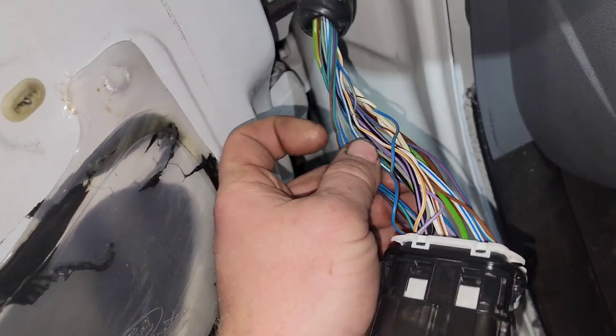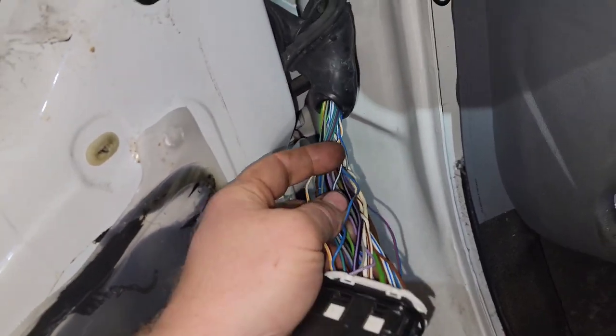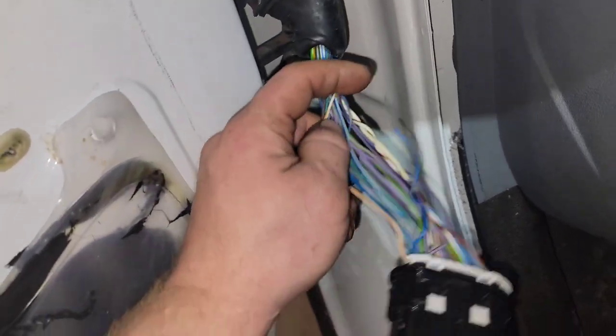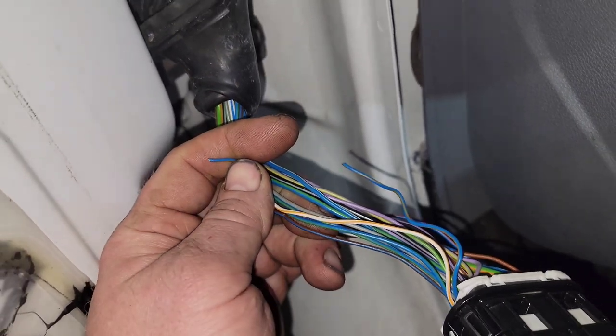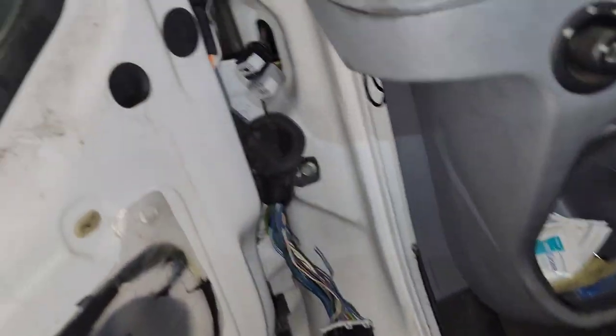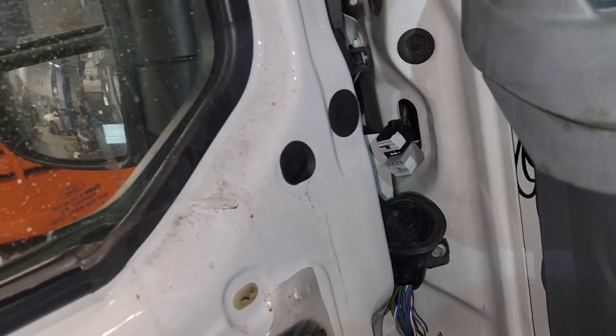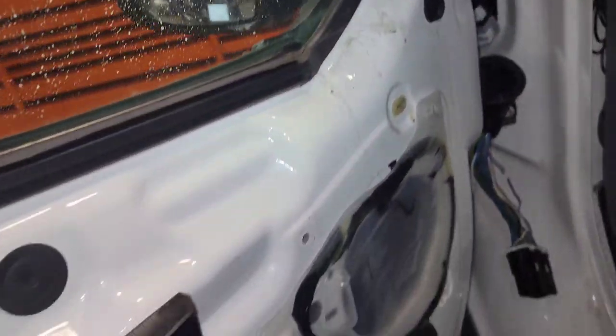This one's pretty much — both these last two I touched are almost all the way through broken. And there's the other half of that broken wire. It's real bad in these Transits. In the F-150s, unlike the rear doors, they break right here. That's a B1313-93 for a set RCM code, so we're gonna address that.